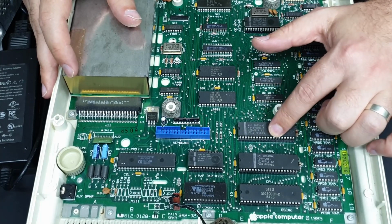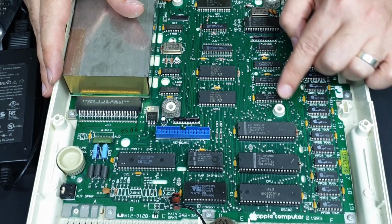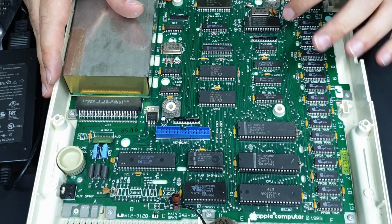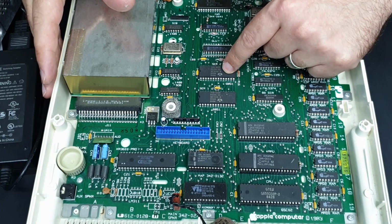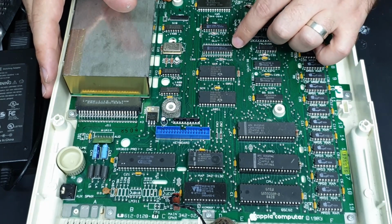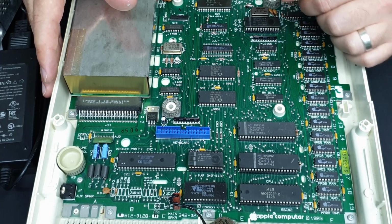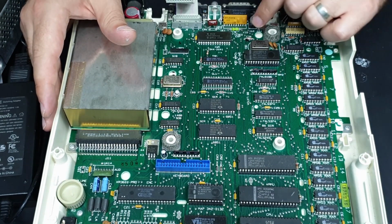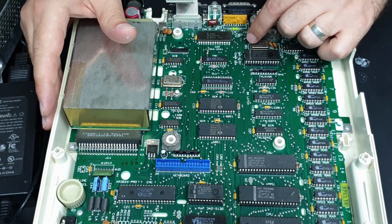IOU, I guess input output unit. There's some 74 logic. What is this up here? Character generator. Serial 1, serial 2. So I guess they do some IO stuff as well. Some glue logic, which is just called glue, GLU. TMG could be to do with timing. Not sure what TMG is. Could be timing.